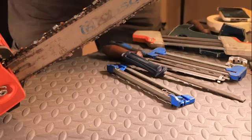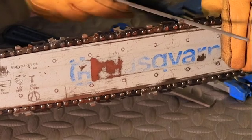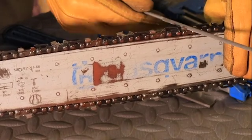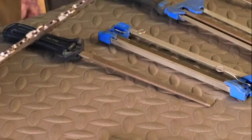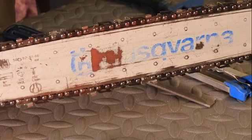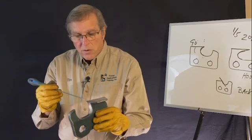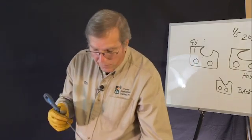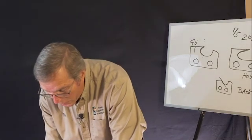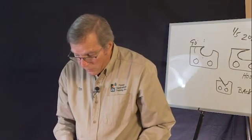And I can tell you right now, it takes as many strokes as necessary to get that surface back on there, because you have to get all the way back up to that point. If you look at it, you don't want any light reflecting off of the chisel angle at the edge of the chrome there. The cutting surface on the tooth is a very thin layer of chrome. And if you have any rollover or damage there, that chrome has to be reestablished to really do its job. So when we start to look at that, no damage can be there. That flat file takes that metal that's bent or damaged, abraded off of it. Then we can take our file and put that back on. Now I've got that surface back to where it should be. It's probably taken about 10 strokes, something like that.